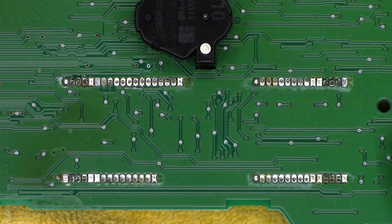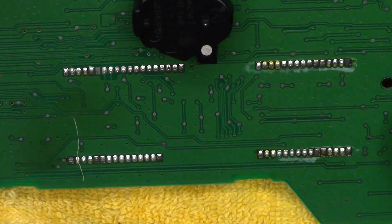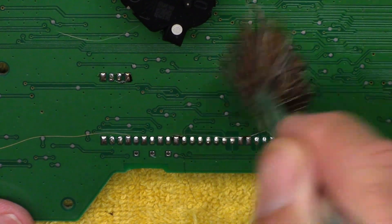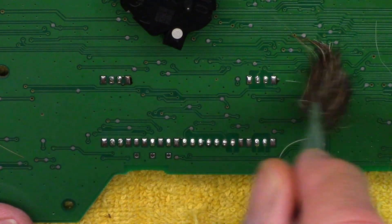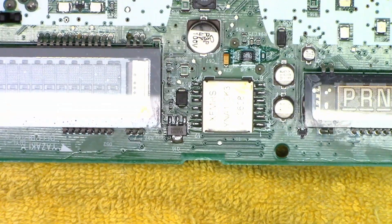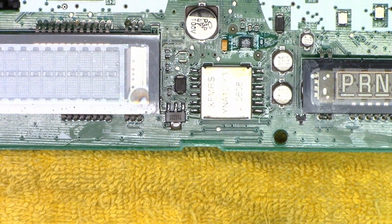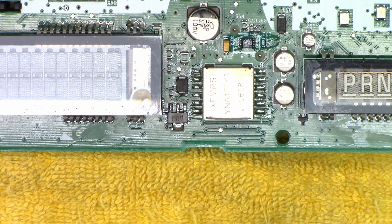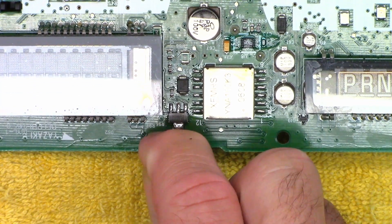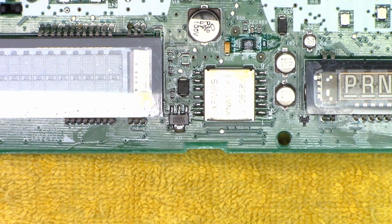Now acetone to the rescue. I think that's going to be good. I'm no Jeff Cortex — he's like the master of GM instrument clusters — but hopefully this will take care of the customer's issue. Just re-soldering that transistor, it might be a FET, might be a bipolar, I'm not sure. Is there a piece of fuzz stuck in there? Oh, just a scratch on the board.